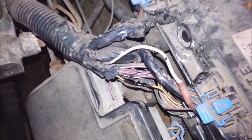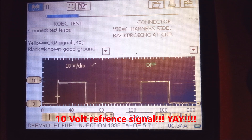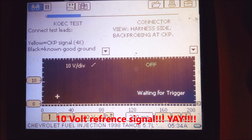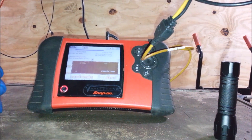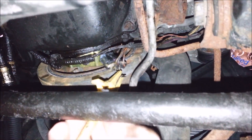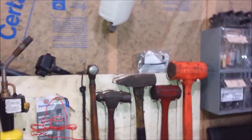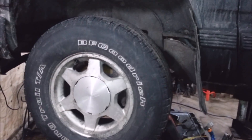Liquid tape on the wire — two coats. It's getting a lot stronger signal. I went under here and used a T-pin. That crankshaft sensor probably did have a problem with it, because this new sensor has got a lot stronger signal. I did a crankshaft sensor relearn with the Autel MaxiDAS. You're going to want to do a relearn if you ever do one of these sensors — it's just a good idea. And that's it.